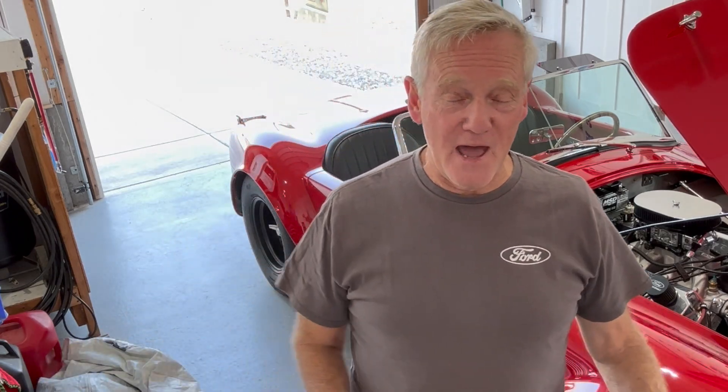So the distributor that I have in it was locked out — that's how you need to have it with the Sniper. And honestly, I had it set at 32 degrees; it was there all the time. There's some good and bad to that, but the biggest thing is you need timing that moves around for the demands of the engine. So we needed that.